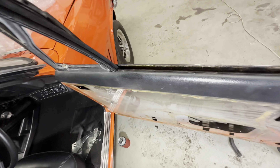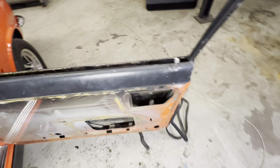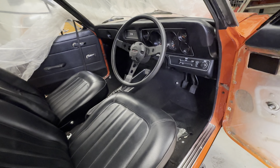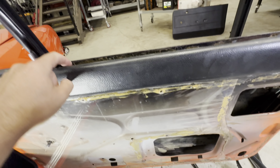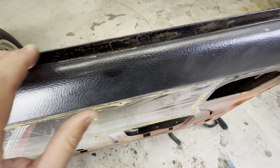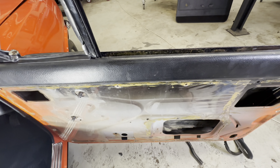I'm assembling the doors today. I do get a lot of questions asked about how these things go back together. This one's got the bailey channel already in. The previous owner tried to attempt to put this together but obviously it wasn't working out, and ironically that's why he called me — how did it just go back together? And then it went from being a race car to what you see now. There's a fair bit to do on both doors to get these rubbers to line up and to get these quarter windows to work properly. This one's got interior felt stripping — these are really hard to get in — and you've also got your outer door belt rubber.